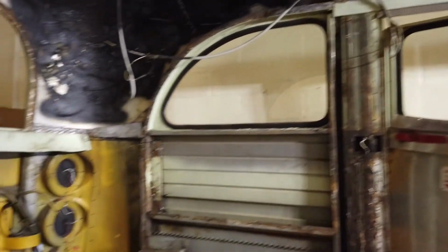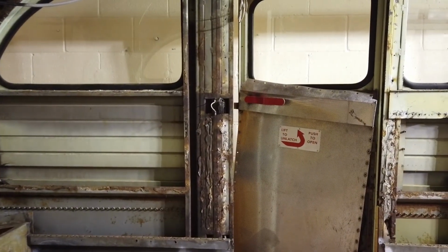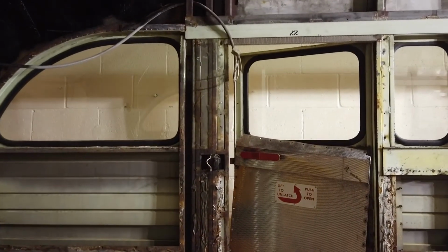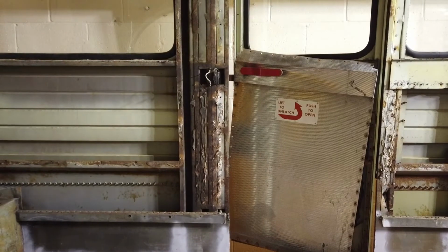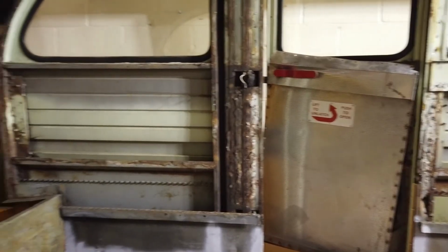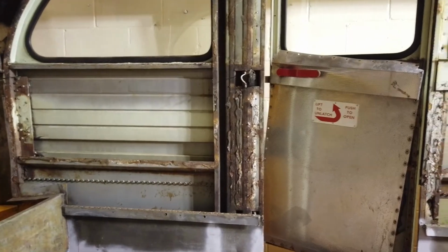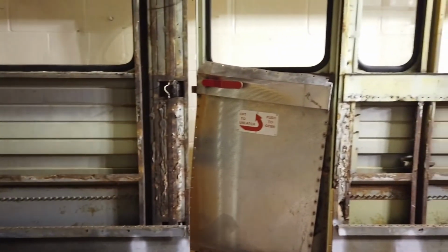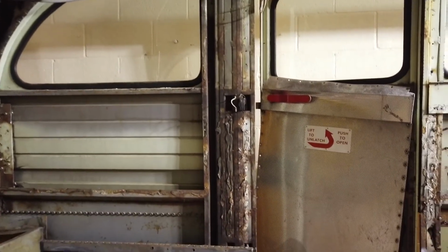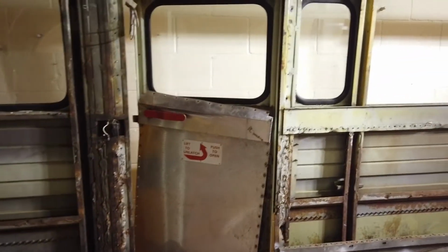And I would be worried about this back end of the bus kind of tweaking the door and bending it so that the door at the bottom down here, the opening would be narrower if it bent at all. So I'm going to weld a piece of iron across that area above where I'm making my cut to strengthen that joint right there so it will not move when I make my lift. Then I'll be welding those in, and I'll be welding that one in, and that's enough of me talking today.